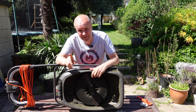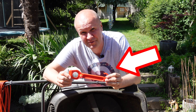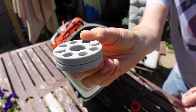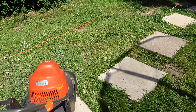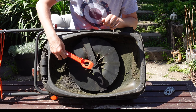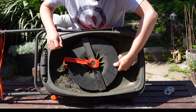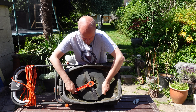I'm going to try it now on camera, step by step, so that you can follow along. You need a tool that came with the mower — bizarrely, we've managed to keep hold of ours, as these always get lost. If yours is missing, I've put a link in the description to one you can buy on Amazon. The tool has a strange hexagon shape on the bottom that fits the bolt exactly. You've got to hold the spinny thing by the round part — not by the blade, because that would be quite painful — and then turn it anti-clockwise.